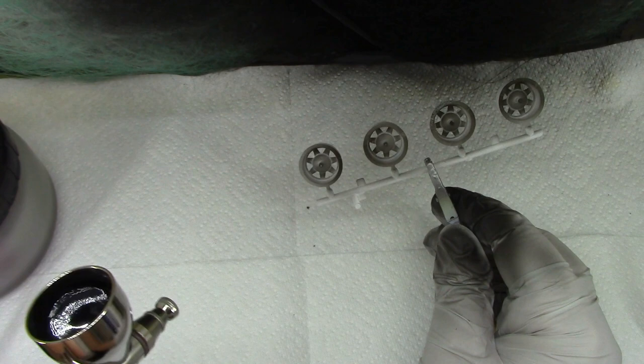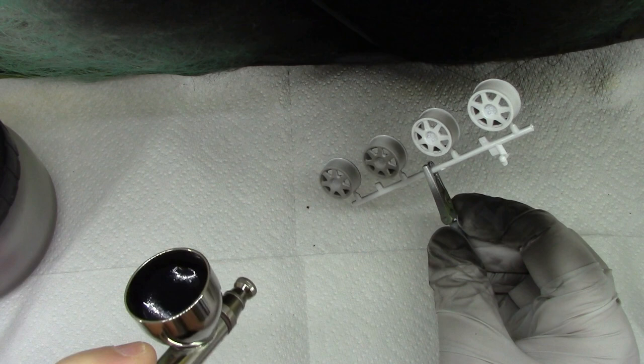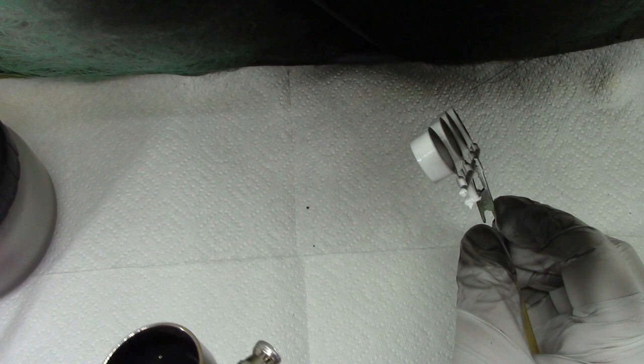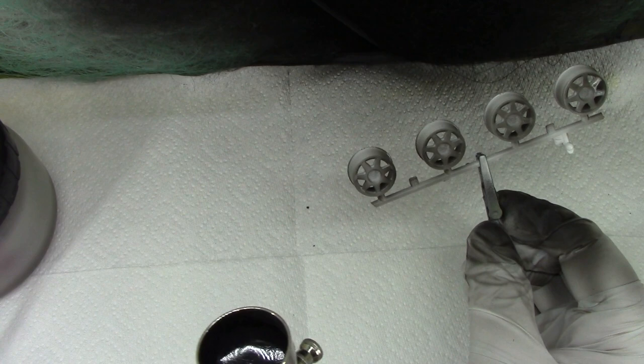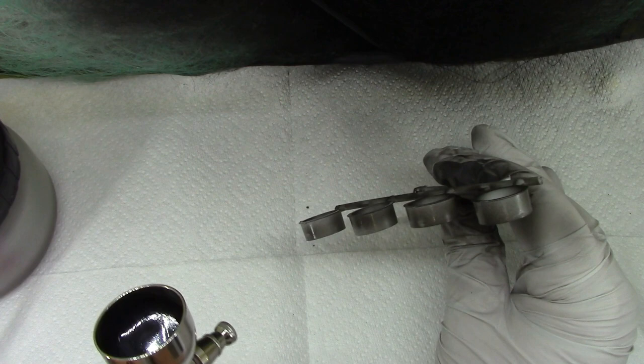They're going to end up in Subaru Alloy Wheel Gold color from Zero Paints. Yep, Subaru Wheel Gold. But in the first instance, they're getting primed black. So again, it's a case of getting a nice light dust coat down. When it's really light and dusty, it flashes off incredibly quickly, so it is very quickly back in with black for what is essentially the second coat.